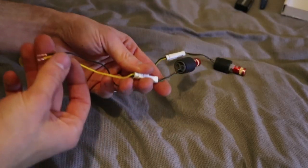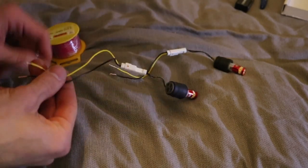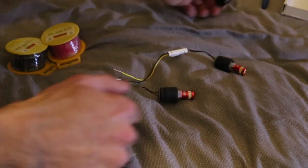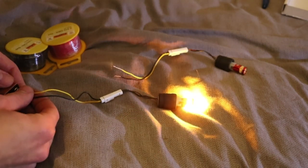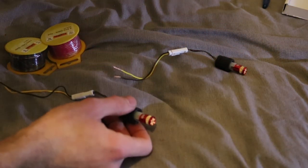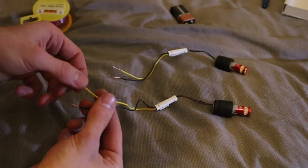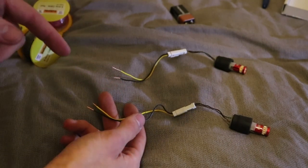I've just actually cut off the indicator wires. What I'm going to do is add some more wire to these to make them a lot longer so I can feed these all the way down to the wing and the side repeater to get power for the indicator. I've just put in these Auto Beam Performance bulbs for the indicator and they do look pretty sick - I've got a battery here and they're super bright. What I'm going to do is just cut off a couple of lengths of this wire and solder long lengths of wire to these, and then with that wire I can literally just find a power source for these indicators and wire them up tomorrow.